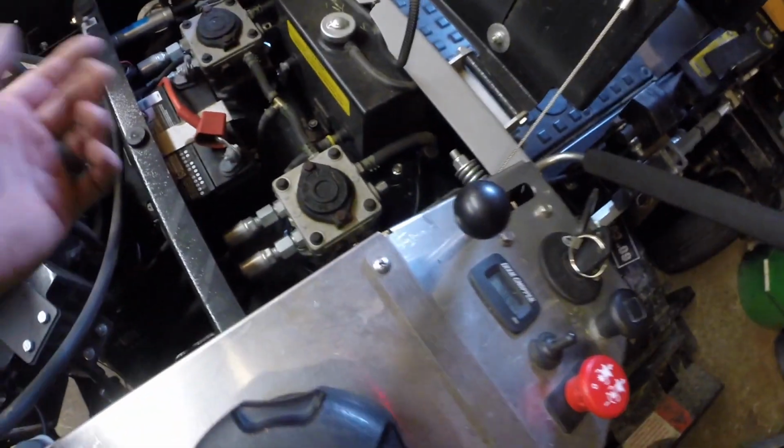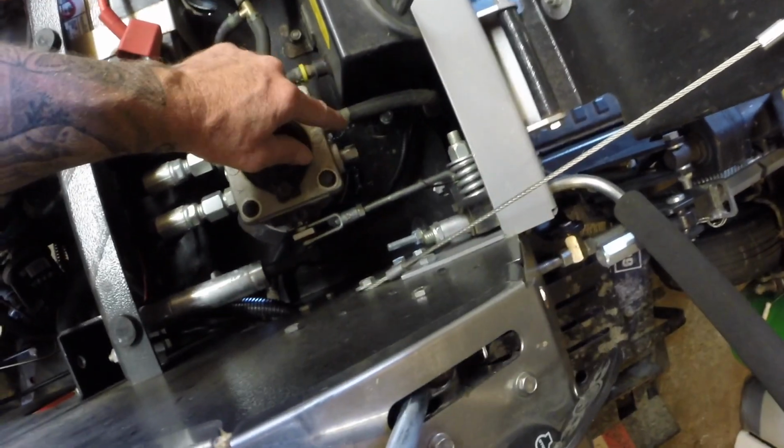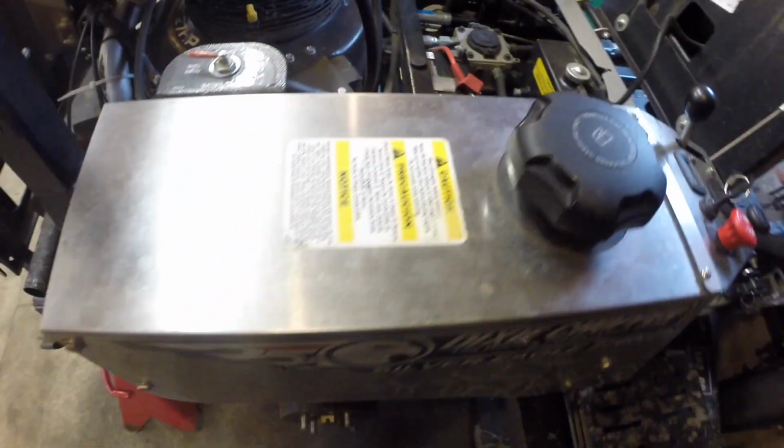So to get this apart, like I said, you got to take those off. There's 2 bolts that hold it on, one there and then one up front. And then also you got to take your belt off the bottom pulley, sorry. So I'll grab my creeper, I'll roll it under there and show you why I believe it's the right side.